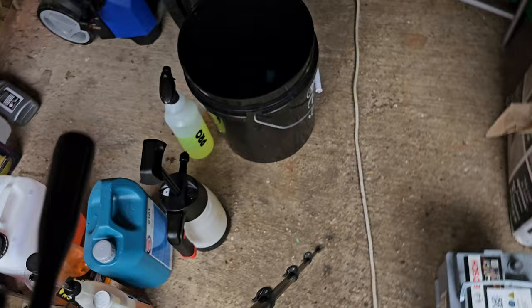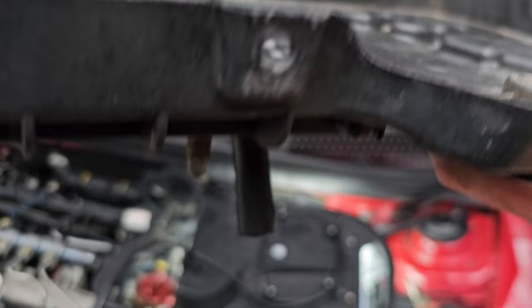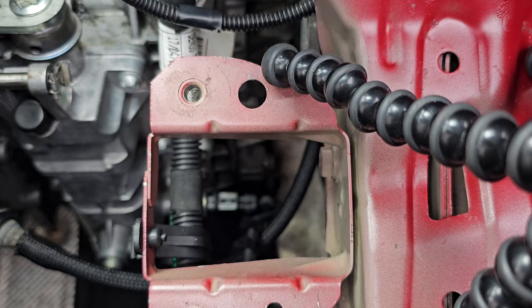The only thing I will say when putting this battery cover back on, if you're going to do it the way I did it, is when you put it back on, there are two little drains. This drain's fine in this corner here, but that hose there gets easily kinked and it goes straight down the middle there. The way you slide it back on to get it over that stud, that front hole, it must be a common thing to catch and end up kinking. It's not gonna flood your tray or anything, you've got two drains, but if you're gonna put it back in, may as well get it back in properly. But yeah, sorted. Hopefully I'll cut down all the messing around I had trying to find the best way to put it in.